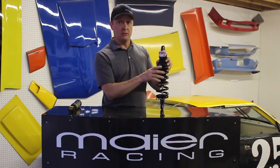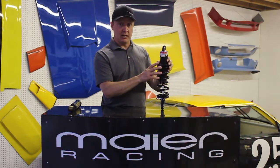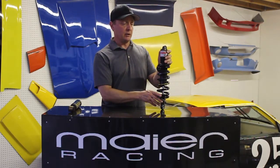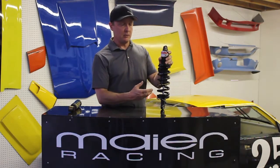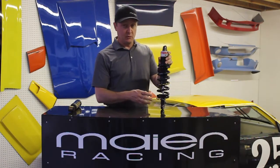However, I do sell a T-on-top and T-on-bottom steel-body Integra shock for stock replacement. Basically what we're trying to encourage, and the reason we're saying shocks are so important, is on the back end of the car you want to make sure when you're standing on the gas that you're not getting wheel hop from hard acceleration and you're not getting wheel hop from hard braking.